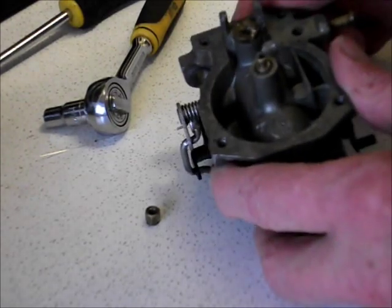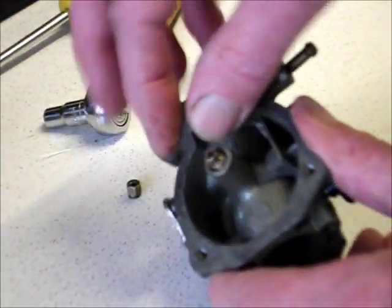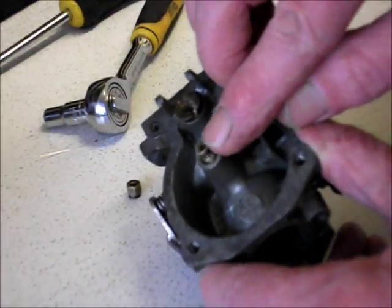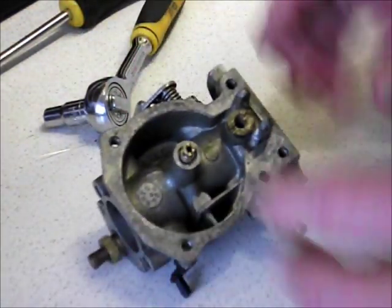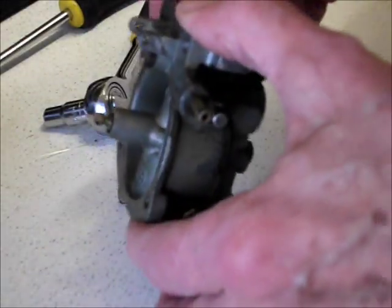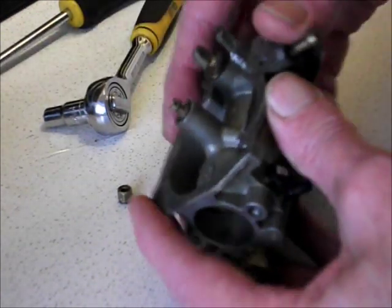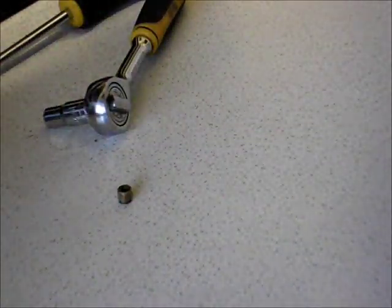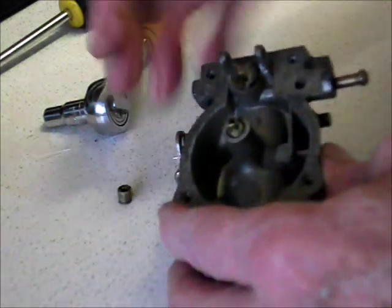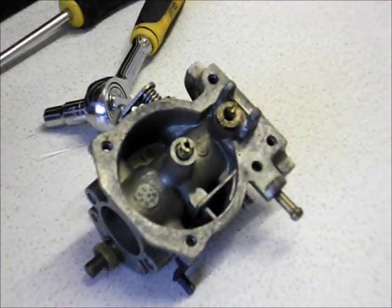Anyway, thinking about this, I think I can get away with it. There was a bit left inside there, so I've screwed the central jetting. We'll have to see — watch the next episode and see what happens when we try and start this. Maybe it'll go, maybe it'll go mad, maybe the bleeding thing will blow up. Still, it don't owe me nothing — it was a present. Why that snapped off I don't know. Brass into aluminium, seized itself in there. But give it a blow — it's working. It may work, it may not. Bit of excitement — we'll carry on anyway.